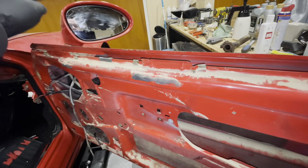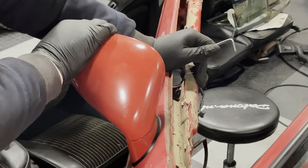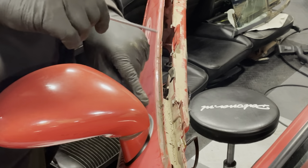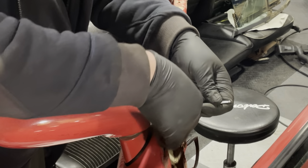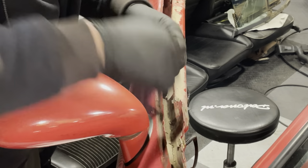To get the wiring harness out I also have to take off the mirror. To remove the mirror off the door, you just rotate it this way — there we go. Inside there's a 5mm Allen bolt that we just have to loosen up, and it's coming out nicely.